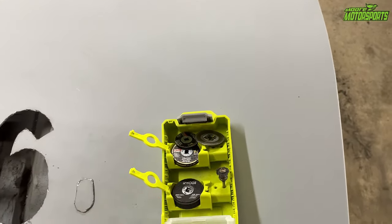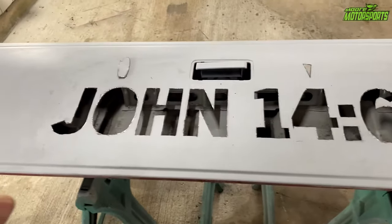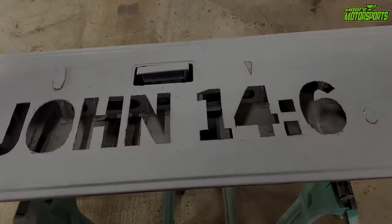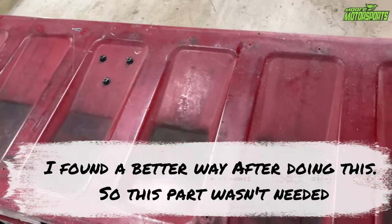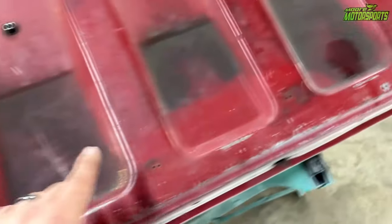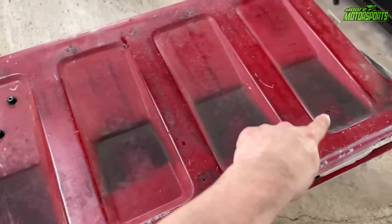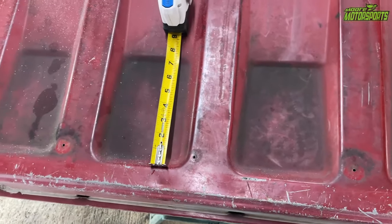The hardest part was the curves — once they get down to a smaller size you can fit them in there better. I'm going to go ahead and get this all cleaned up, flip it over, and then we'll be focusing on the back side so we can have access to putting the plexiglass and lights in there. Now that I got it flipped over, I need to make an access panel because this one does not have one. So I'm going to be cutting out six to seven inches of area here and on this side so I can slide the plexiglass in with the LED lights behind it.